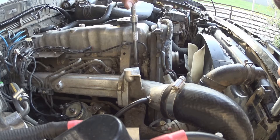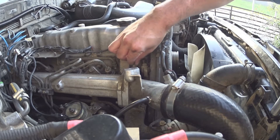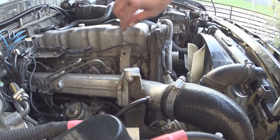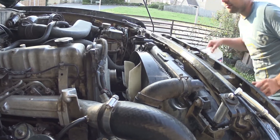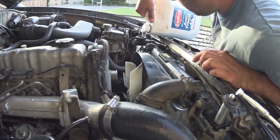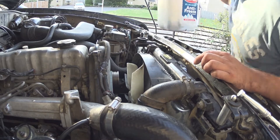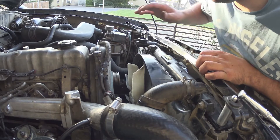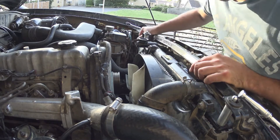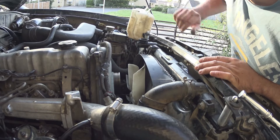To do this back up, you don't have to go nuts on it — just what I'd call fist-tight, because obviously it's a tapered thread, and if you keep tightening it more and more you're just going to bust something. Pop that little spade terminal back on that, and then you can fill the radiator again. Let's chuck some coolant in there. We let a little bit of coolant out, so we'll start it up again and give it a couple more squeezes and put the cap on — should be done. Obviously we've got to put the expansion bottle back on. It's not really an expansion bottle, is it? It's a puke tank.